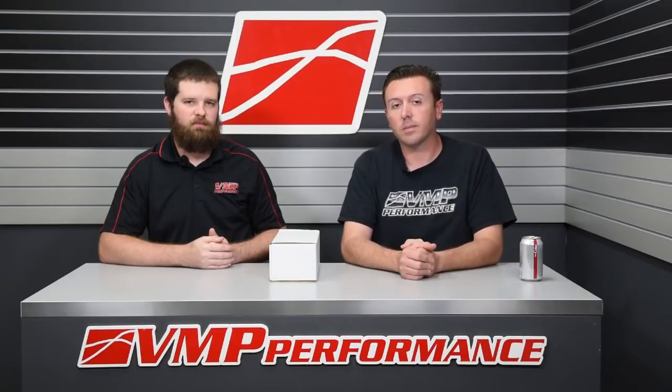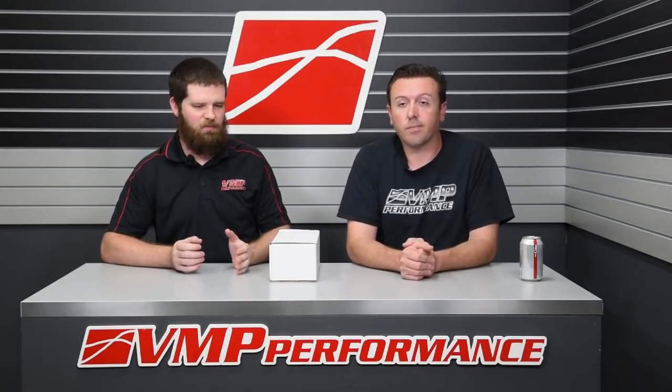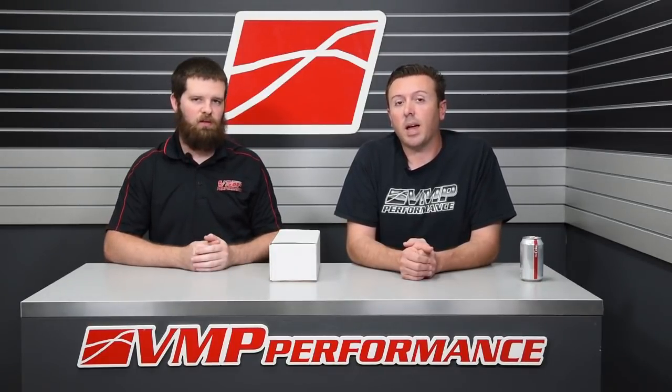Lauren says it's got a 17 GT, an '07 GT500, and wants to upgrade the supercharger. If I understand correctly, the Gen 3 makes the same power with less boost than a Gen 2. That's correct. Would it improve the longevity of the stock block over a Gen 2? One could argue that a blower that takes less horsepower to drive at the same pressure ratio and blower speed would in theory stress the engine less at the same boost level than something that requires more power to drive and is less efficient.